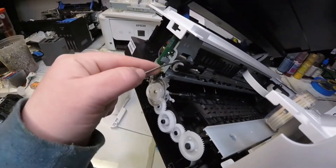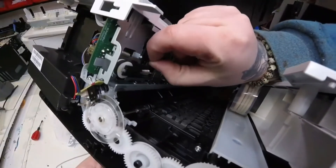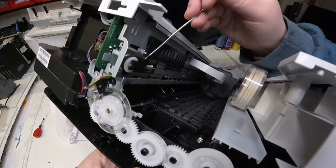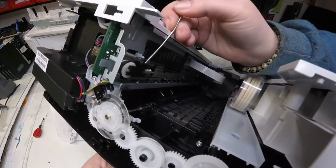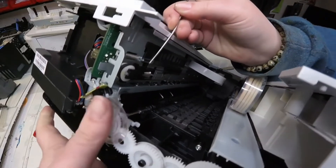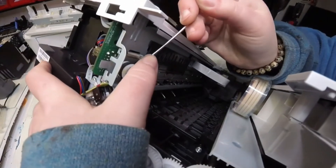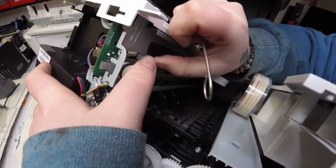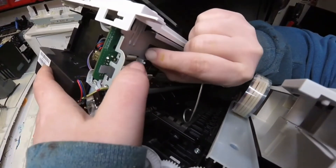I have this little tool in my hand to help me work with the encoder strip. It's a little hard to use with my fingers — I sped it up a little bit — but you'll see there's a metal hook that comes off of this rail, and that's where I need to hook my encoder strip. There'll be a little blank space on your encoder strip, and that's what hooks onto this metal piece.